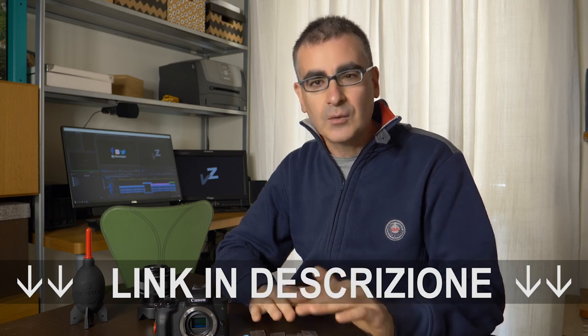This product is not very easy to find in Italy — I got it in the United States — but it lasts a very long time. With this system, I clean the sensor perhaps once a year, because for all other occasions blowing is more than enough. If you are careful about how you change the lens — not leaving the camera with the sensor exposed, doing it quickly, and with the sensor directed downwards — the dust that arrives on the sensor is really a minimum quantity. I do this operation very rarely. I'll link this product in the description, along with another that is easier to find in Italy and still quite good.